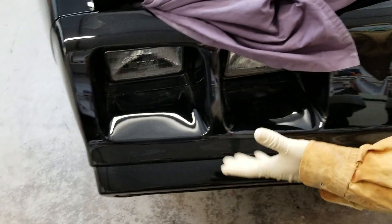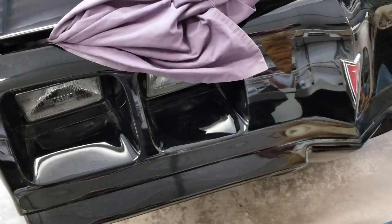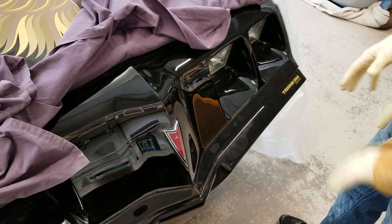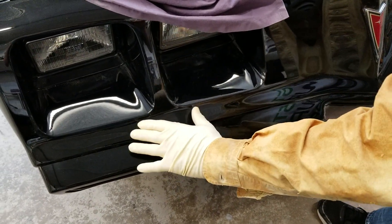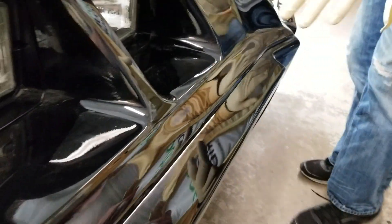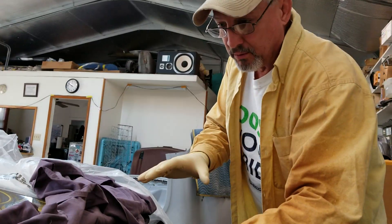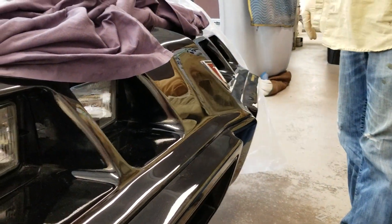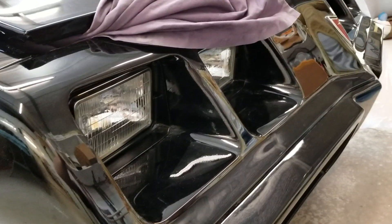This was actually a tricky one. The car was jacked on this side and they actually over-jacked it to where it distorted the front end of the car. There was filler underneath, so we replaced the filler twice to get the right flat area. Then it took us jumping up and down on the bumper, because the brackets had been flexed a little bit to where it sat up on the right side and down on the left. So I had Earl jumping up and down on it — it was crazy, but sometimes you've got to be a little rough to make it beautiful.